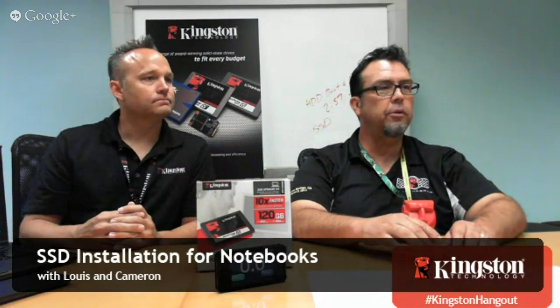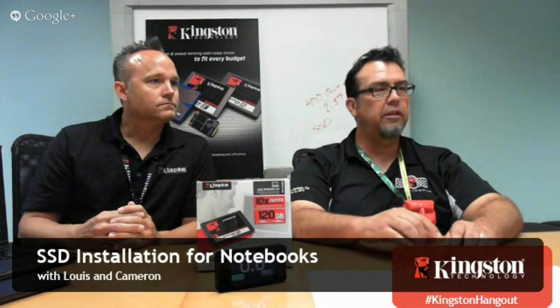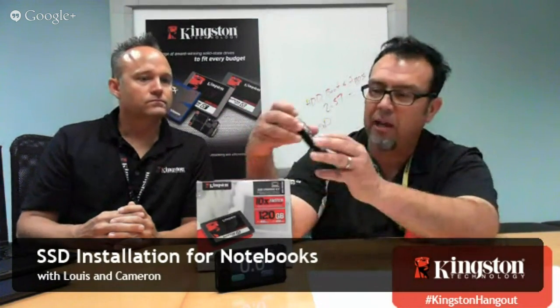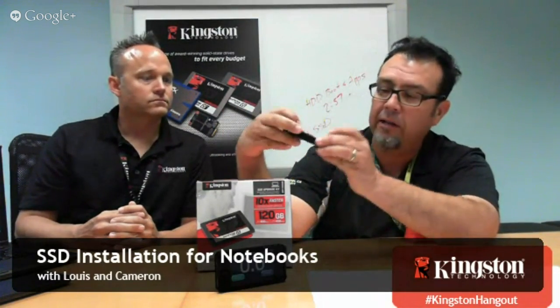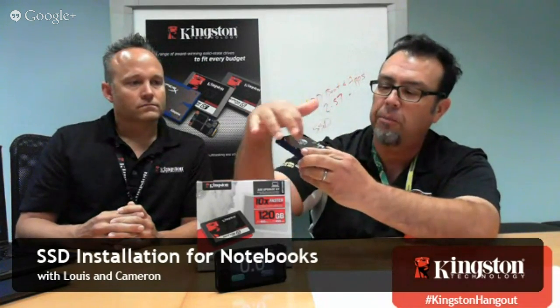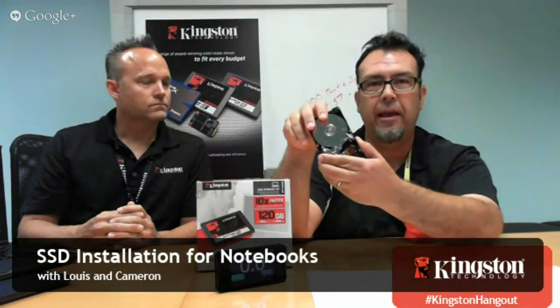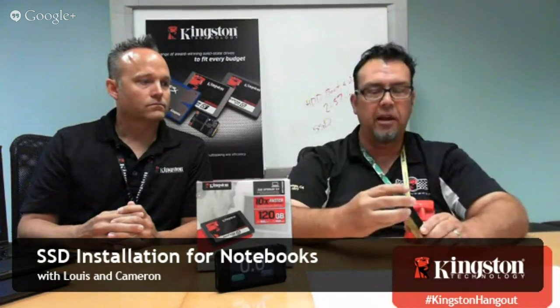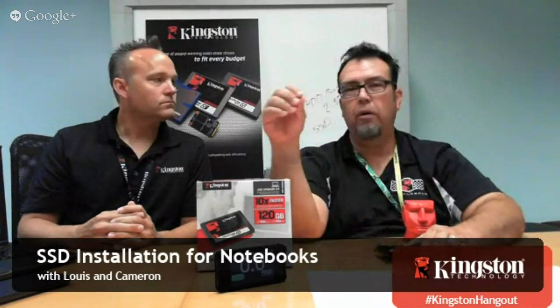All right, one more. Is it true it's not recommended to use Windows defragmenter software on SSDs? Yeah, it is, Richard. That's a great question. Using our hard drive example, there are actually multiple platters on this hard drive, though you can't really see them. When I've got data on multiple platters and I need to assemble that data, hard drives are going to fragment. That's just how they work. Data is not going to be able to be written contiguously over and over again.